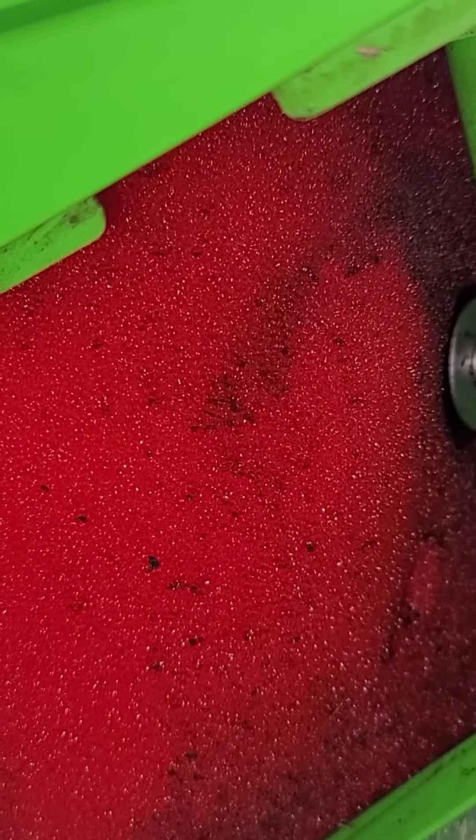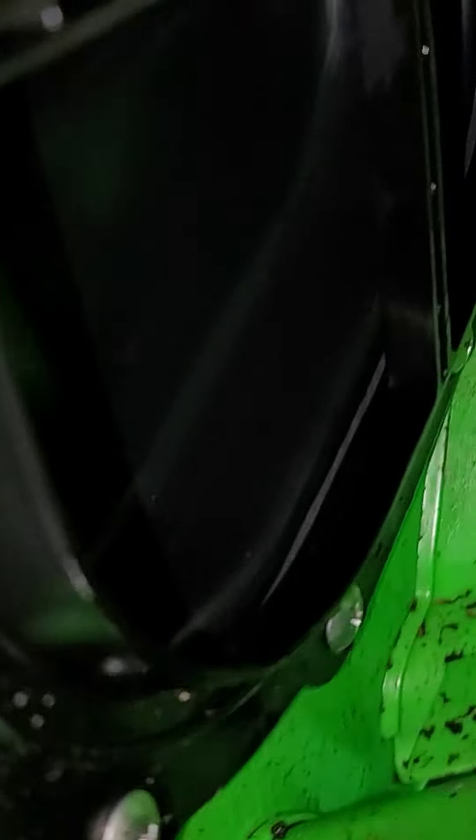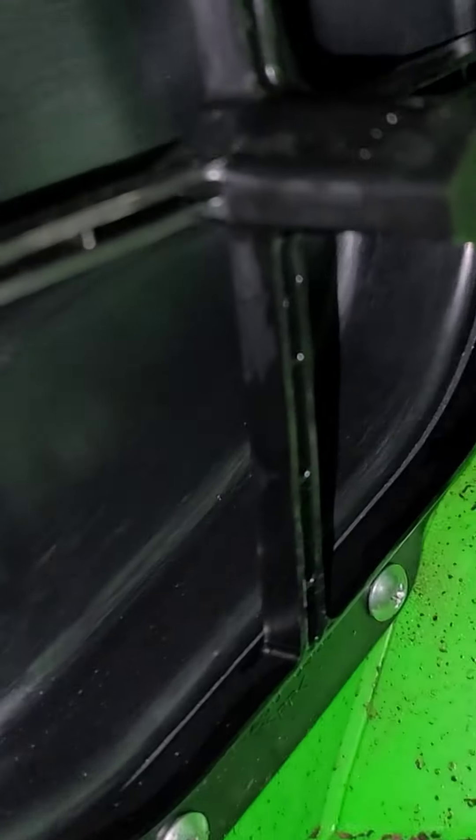It doesn't look too bad, but I might pull it off and cut that screen off the intake — that might be worth cleaning the filter for. So I went ahead and yanked the whole thing out. That's the only little bit of dirt we got on there. The cool thing is on the inside there's like nothing came through — it's still beautiful yellow on the actual inside of the air boot, very clean.